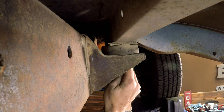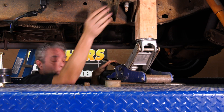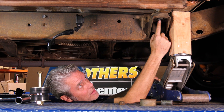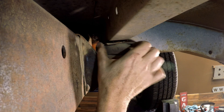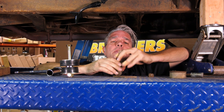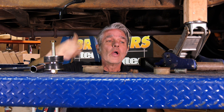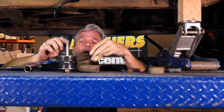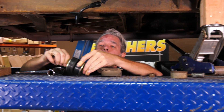Okay, just about there. I'm going to climb on top, take the bolt out, and then I'll be able to slide this out. With the bolt out I'll take my sleeve out, and because that little lip is on there it's still going to be a little difficult, so I'll take the washers off the top and then everything will slide on out. On this particular cab there were two washers on here from the factory, so I'll go ahead and use two — I'll clean one up and use the original as well, so my cab is even just like it was from the factory.